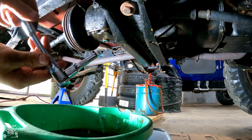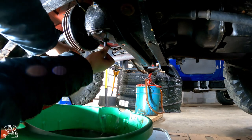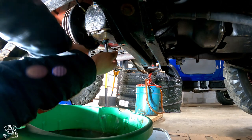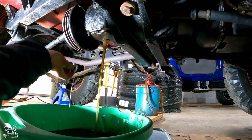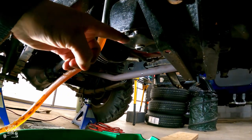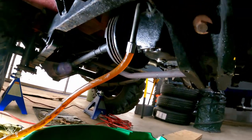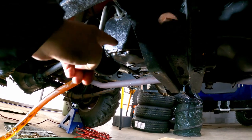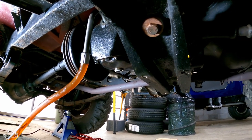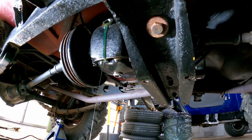This one uses a 3/8 drive — that's the bolt you'll need. The others have been square bolts for crescent wrenches. That fluid looks pretty good — shame to drain it. I put the drain plug back in with new sealing, got my rig set up, and I'm just going to pump this in until it starts coming out the top, then put the bolt back in. And that covers the engine, transfer case, and transmission fluids.